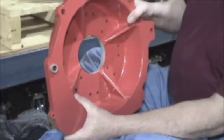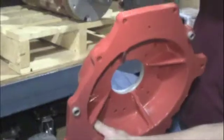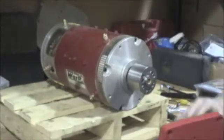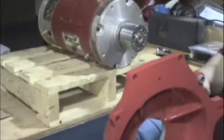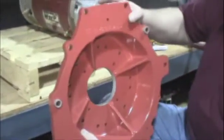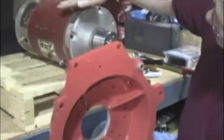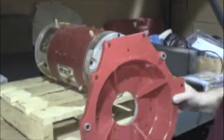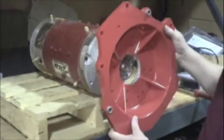One consideration you need to make when you install this is where the motor electrical connections are going to be in reference to the transmission and the motor. This is the top of the transmission. We're going to want the motor leads to be basically in the vertical position, so I'm going to rotate this to match.